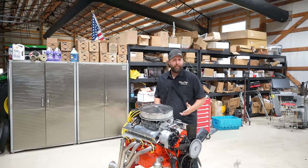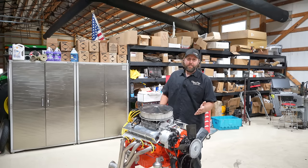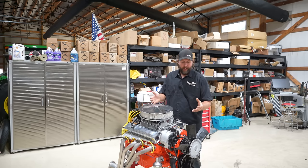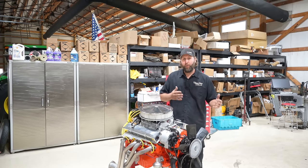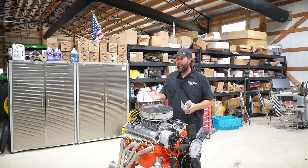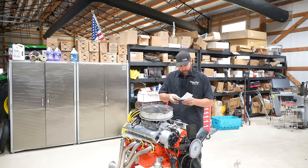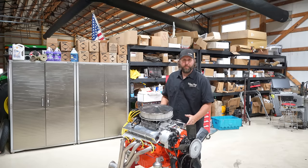I kind of tricked your eyeballs. It looks pretty good, right? It's just a bunch of spray paint. The bad news was when we tore it down, it was starting to wear some cam lobes out. So you can get an OEM camshaft for these still, but you're already spending the same amount of money as a cheap performance cam. So we went ahead and put a Lunati cam in it. The cam and lifter set I got off the Jegs website, literally. It's a model that I really like called Bare Bones. It's a 281/293 on a 112. They work really good with small displacement.